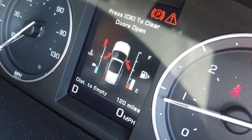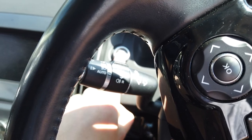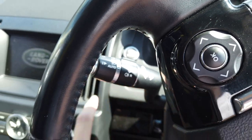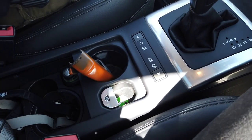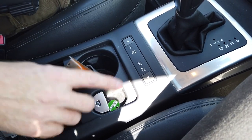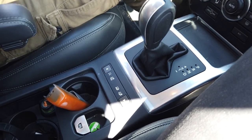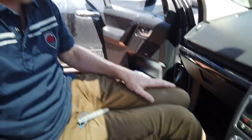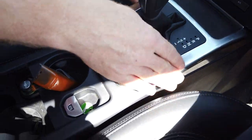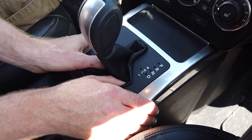Go for neutral and then turn it off. Now if you press and hold it, it'll tell you no, you can't stop in neutral. Make sure you put the handbrake on - pull the handbrake up. Bear in mind if you are stopped in neutral, you're not stopped in park, so you haven't got anything to stop you rolling away. Caution there - your handbrake should do the job. You've been warned.